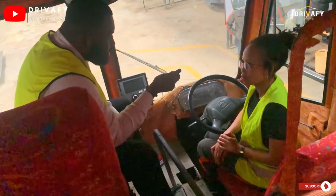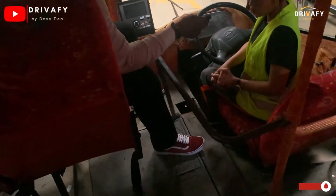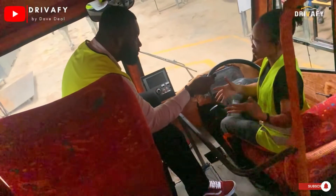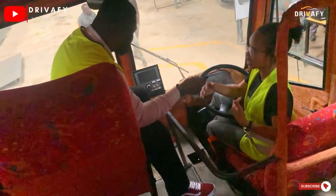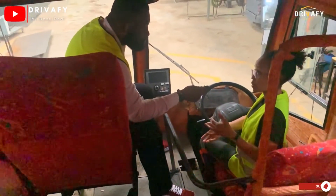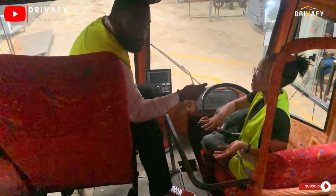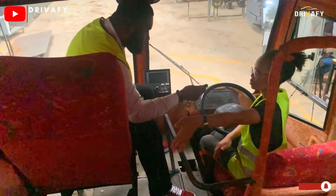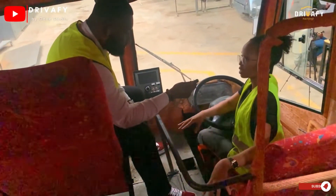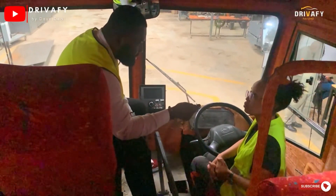Beatrice, where was the engine before you took it out? The engine was right under where you're sitting — in the middle of the chassis but towards the frontal area of the bus. We took out the engine and replaced it with an electric motor towards the center. We also have a battery pack — in this bus we have four battery packs, with a total energy capacity of 120 kilowatt hours. We have 30 battery modules and 180 batteries in total, distributed to balance the weight: eight modules towards the left compartment, six modules towards the right, and 16 battery modules in the center of the chassis.